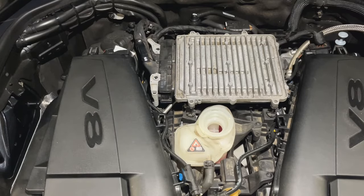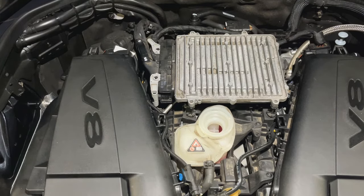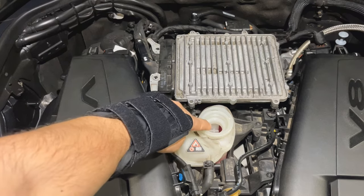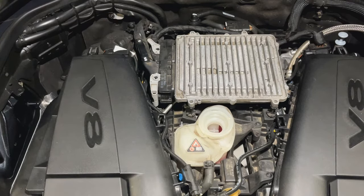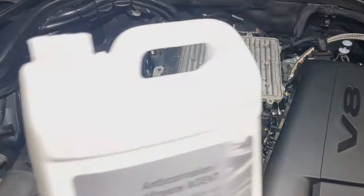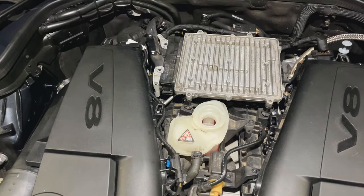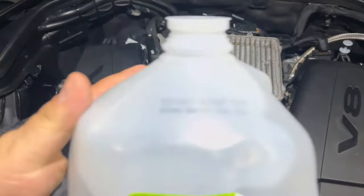It's normal for the engine to use some coolant. But it's not normal to have to add coolant every day or every other day — you shouldn't be adding coolant every other day. Make sure you're not losing coolant from a leak somewhere. The pink stuff you see in there is the coolant that comes from the dealer, and it comes in a pure form. You have to mix it with distilled water — don't use regular water because it has minerals and calcium that you don't want building up in your engine. Use distilled water; it doesn't matter the brand as long as it's distilled.